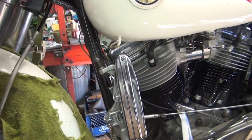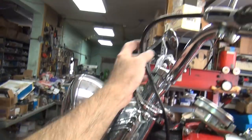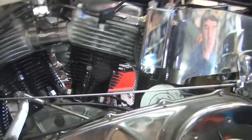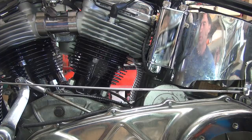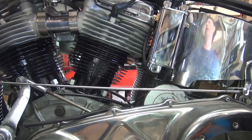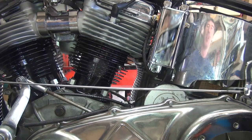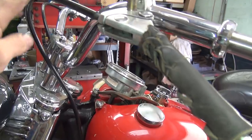For now it's working fairly good, doing what it's supposed to. It's just not quite going over center - that's that last little bit. And it's gummy - I bet a lot of that's mainly in this cable up here. All that stuff needs to be lubed. Okay, I'm going to leave it at that point there. I got this tight - these are tight on here so it shouldn't move up here in the frame. The lever is probably a little bit too high - it should be adjusted down a little bit. I put this out the front because that's how the other one was - whatever the cable works best. This cable wants to go this way for being straight. You don't want to have a bend in your cable - you want to go as straight as you can.